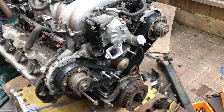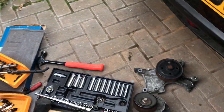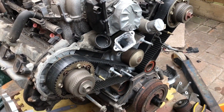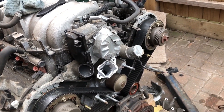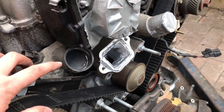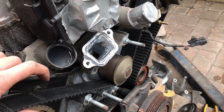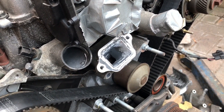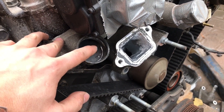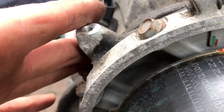We are making good progress - we've taken all the idler pulleys out, the various assemblies are down there, all held in with either 12 or 14 mil nuts and bolts, and they've all come off super nicely. You can hear how windy it is, it's not as warm today. The only thing that was a little tricky to get out was this water housing. There's an O-ring on this side and what looks like a liquid gasket - I'm sure that's not original. This has had a belt change by the looks of things; there's yellow, green, white paint all over the place. Hopefully it's had a belt change - it's got 80,000 on it. This guy just needed a quick knock with a rubber mallet and a bit of WD and he came out quite nicely.